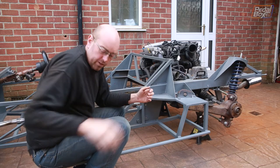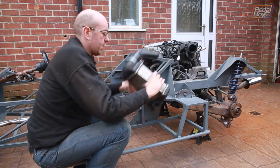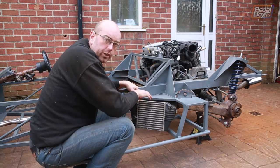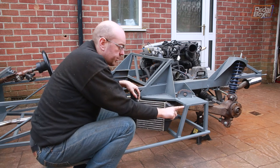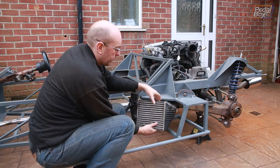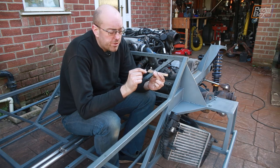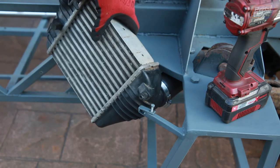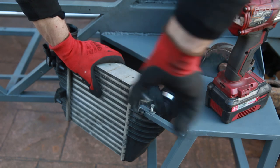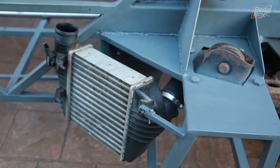The last thing we're going to do before wrapping up this episode is add another intercooler mount, because at the moment this is just hanging on one of these. We're going to add another mount for the back of the intercooler onto the new upright towards our outrigger and onto the wing. The rear bracket design is really simple — it's just a piece of half-inch tube with a notch cut out that fits around the peg, with a little plate across the top that bolts down and holds it securely in place. We'll weld this on with everything lined up, and that should be that done for now.